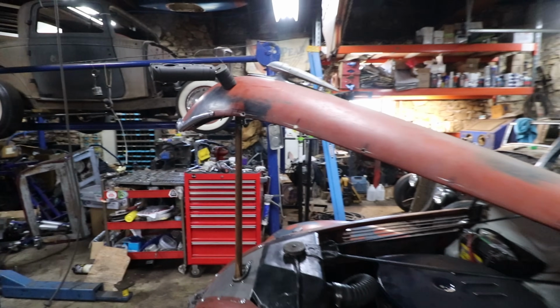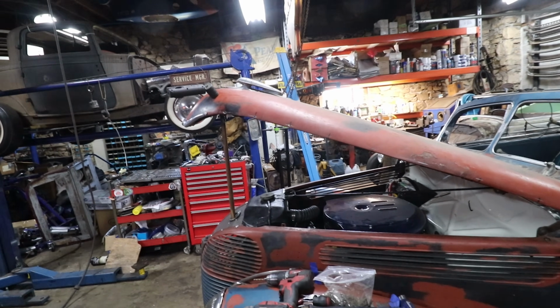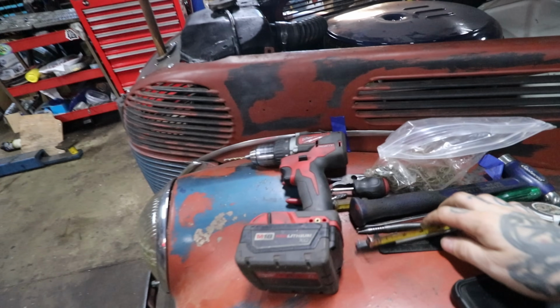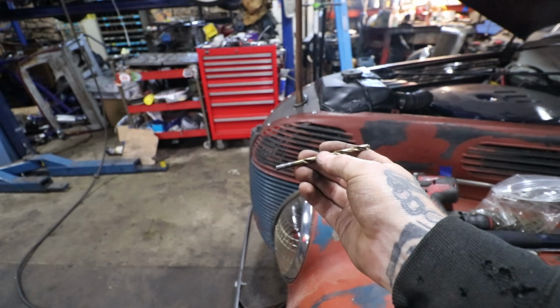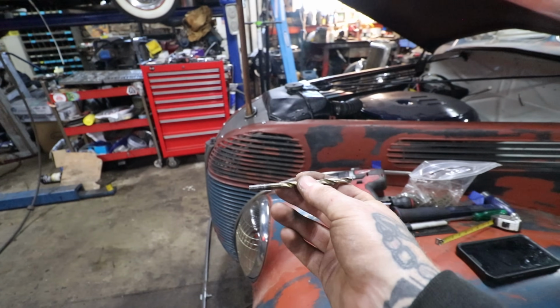I then went on the rear quarter panels of that 38 outside. It's in our scrap bin. The sections of that still had the original holes. So I basically took a drill index out, found a drill bit that was the correct size, which was just under a quarter. I forget what the size is, but it was either a 64th or a 32nd under a quarter.